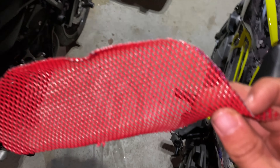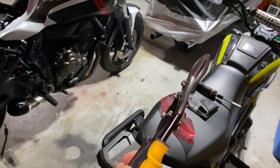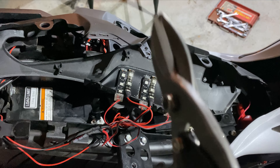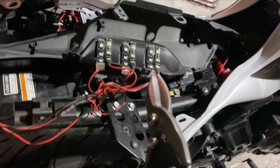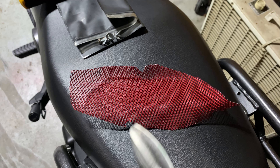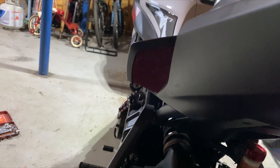If you want tips on how to cut this mesh — you can buy it on Amazon too, it comes in rolls. A tip to cut it is with tin snips, very carefully. What I did was while you have the panel off before you set the LEDs up, do the mesh first. This side is not the same as the other side — the left side's not the same as the right, they're just mirrored opposites. You take this black piece before you do any of this to it, literally just take the piece out, undo those little seat clips, the little circle clips. And before you cut the divots or anything, just get the shape of it because it has to look good. You don't want it to look bubbly or trashy.